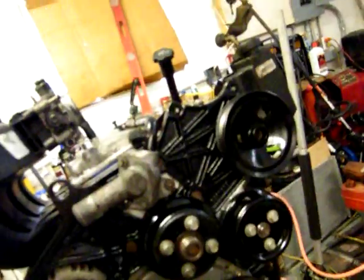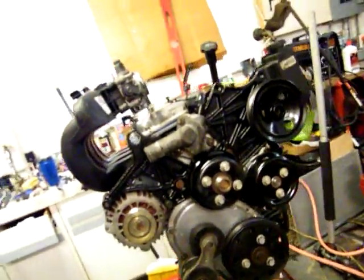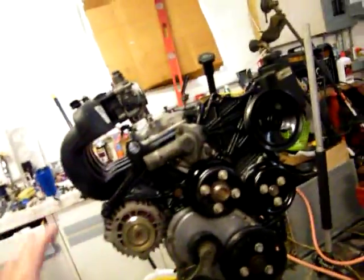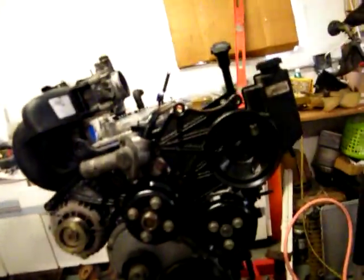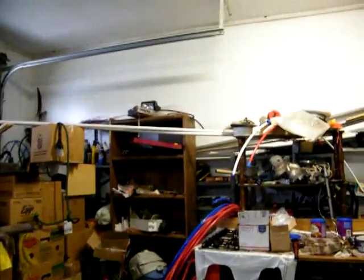Right now the plan is to take it apart. I've located all the bolts, they're all in place, remapped everything out so I can remember. I'll separate the bolts for exactly which one goes where — I have them in several cans — then take the head off, put the head gasket on, put the lifters in, put the push rod guides in, and put the rocker arms in.